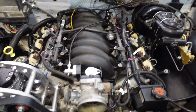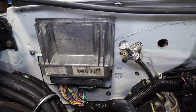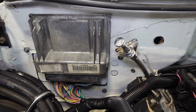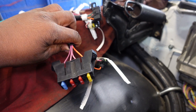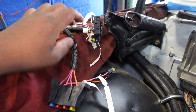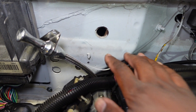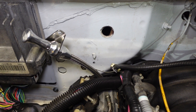Our transmission wiring is plugged in down there. We're going to mount our PCM right here because we are using a factory setup — there's just not a lot of room in there with the vintage air and such, so we opted to put it out here. Then we have this group of wiring right here which is a fuse block, as well as our very important OBD2 connector and a few important signal wires. We're going to pass this bundle of wiring through this hole right here that already existed in the car, put a grommet on it, and make our connections inside.